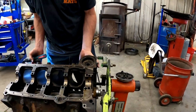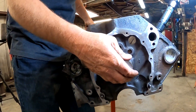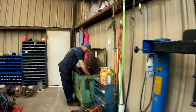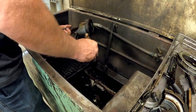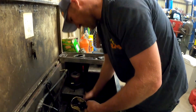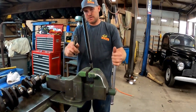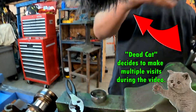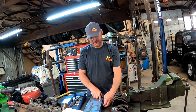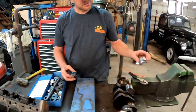She's pulling in straight, that's what we were after. We put this thing up so we're not screwing it up because we still have to put one of those in — we ruined one. Luckily it's the back one so I can just take the motor off and set it on the stand. What happened is I didn't have it fully engaged and it tried to pull the lip through the bearing and just ruined it.